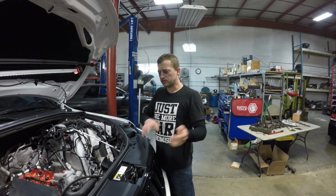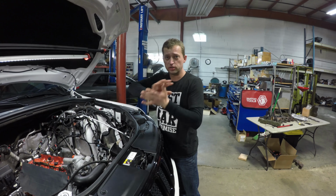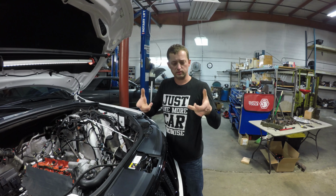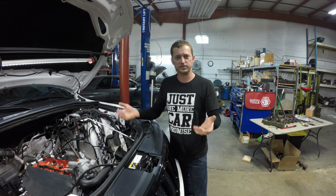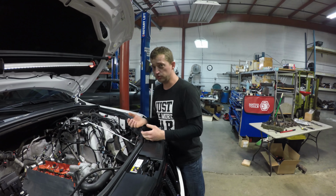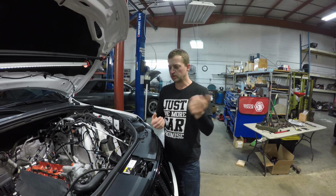Valve train. A lot of people don't understand that when you put in stronger valve springs, you technically lose horsepower, because it takes X amount of horsepower to open and close them, and open the valve spring itself. Plus, you're putting in heavier push rods, etc. Piston rings that are thicker are going to take more abuse, but they actually rob horsepower. You know what I mean? Yeah, I get it.